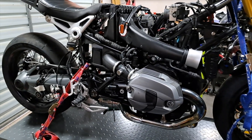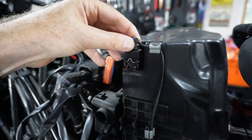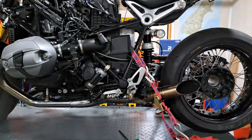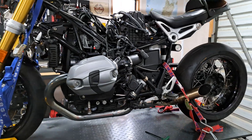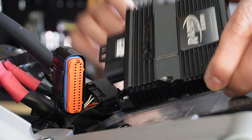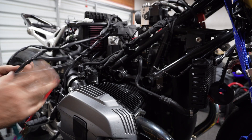You may be wondering about air — and there is naturally an airbox sensor. However, this is not directly intercepted by the Rapid Bike module. This sensor reads the airbox temperature. Rapid Bike only requires direct information from the previously mentioned sensors, which is why you won't find a Rapid Bike connector for the airbox.